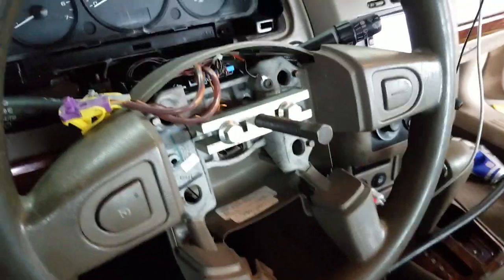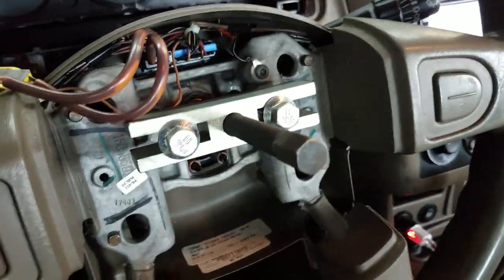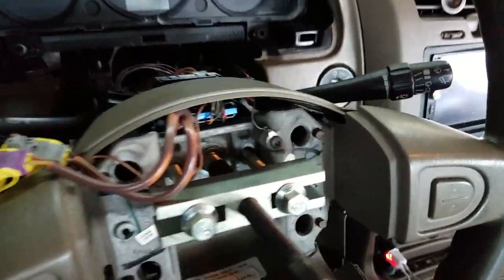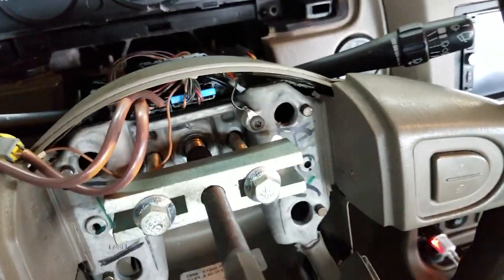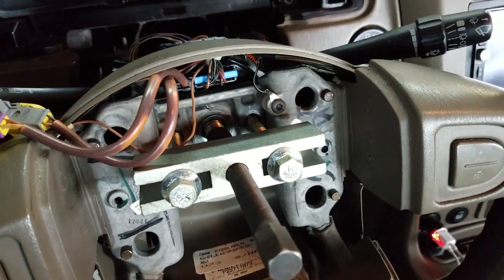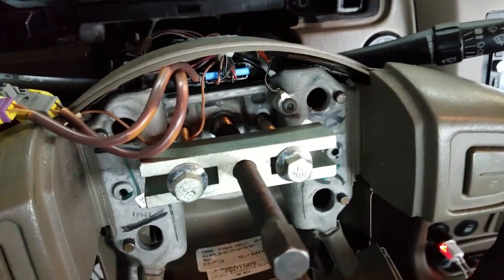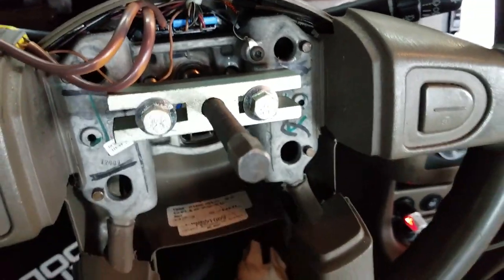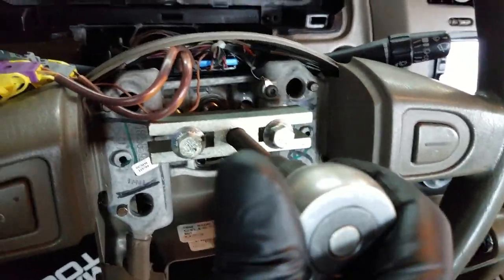One second. Okay, so now I've got the steering puller fixed. This was a bit of a strange steering wheel. The holes for these bolts didn't have any thread, so I had to find the biggest bolt that would kind of just work its way in there and do my own threading. So we'll see how well this works. It may not, but I really hope it does.